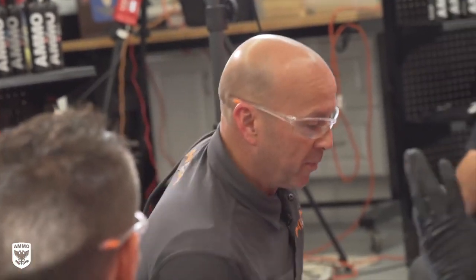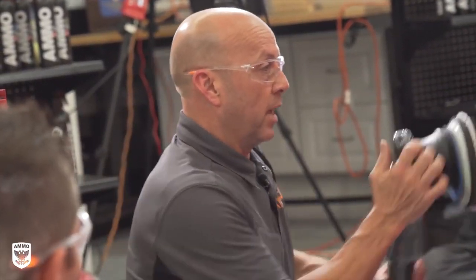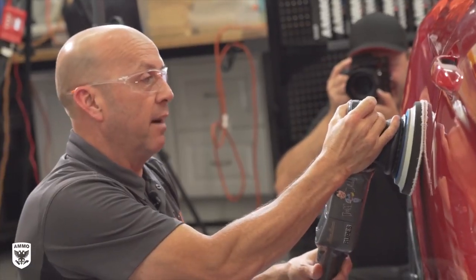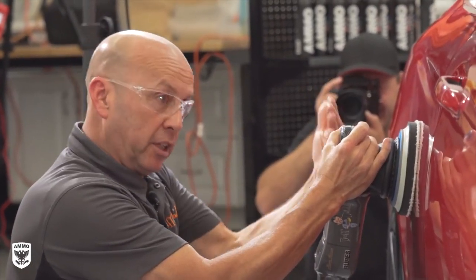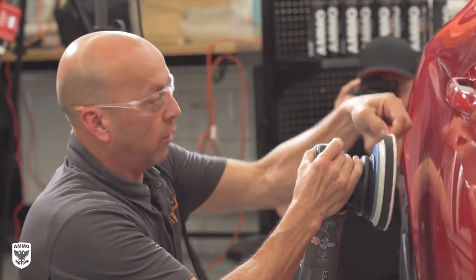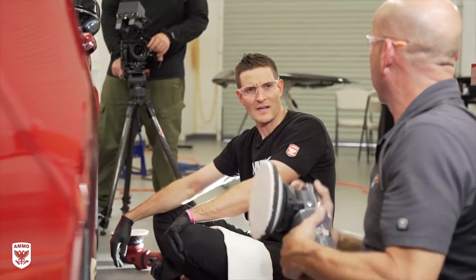Do you think it's old mentality — old thought process from diminishing abrasives that never went away? It could be. But the other problem is, if you do lighten up on the last few passes and unload the pad: if you have the pad planted and then lighten up, it's unplanted, and your speed jumps up. You're not squeegeeing anymore. If you have a random orbital and the backing plate doesn't fully support the pad — which a lot of them don't — now you've got a change of speed, the pattern has changed, and anything stuck to the strings not in complete contact is now dragging and scouring. You're basically throwing a curveball in the last second of your polish.